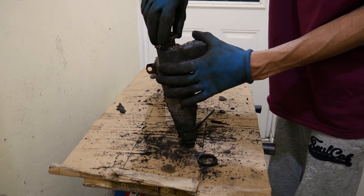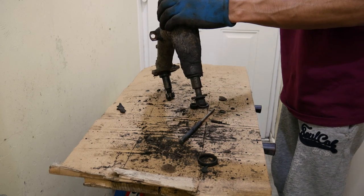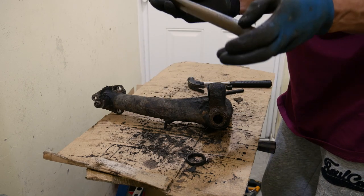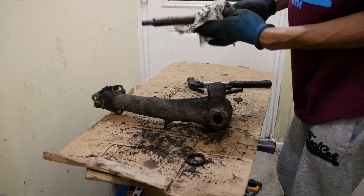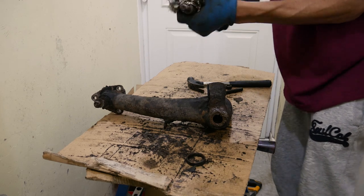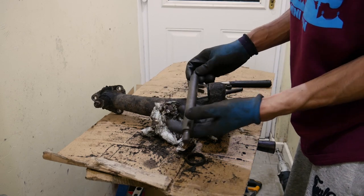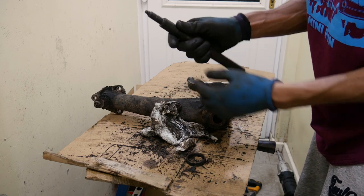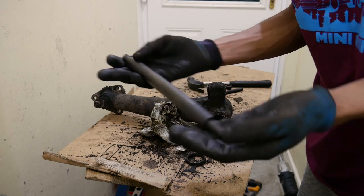The final bit is the master pin. Undo one of the retainers and as long as it's well-lubed it should come out with a little resistance. That's the pin out — mine's got a bit of rust because water must have been getting in. This pin was fully seized a few years ago; I managed to get it out and at the time I just used sandpaper cloth to clean it up. The finish is just rusty and pitted everywhere. On this side there are burn marks where the roller bearings overheated and bonded, and the brass bush is completely worn through the pin.